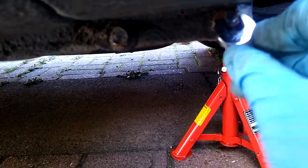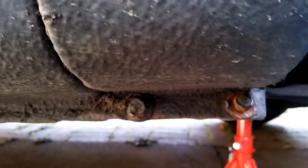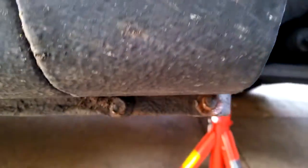This is the second time I've had to do a wing on the car. When I bought it the original passenger side wing was rusted, so it's not the first experience I've had — I came into this with a bit more confidence. There are two bolts that might catch you out — right down here underneath. The paint had built up over them, so you might want to use a Stanley knife or screwdriver just to break away the paint so you can undo them.